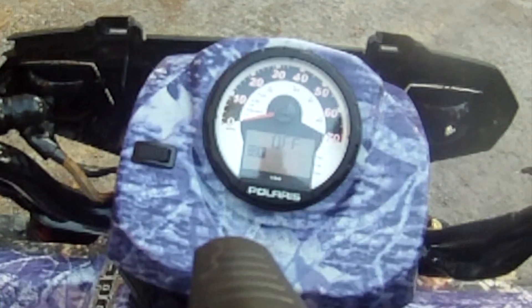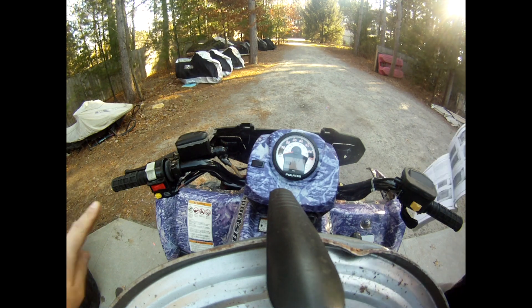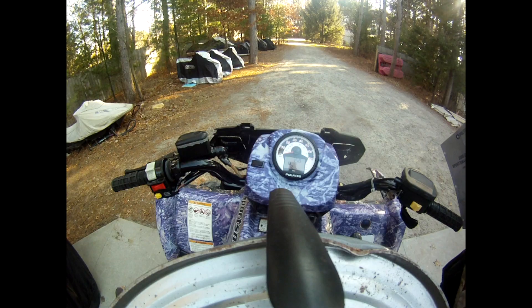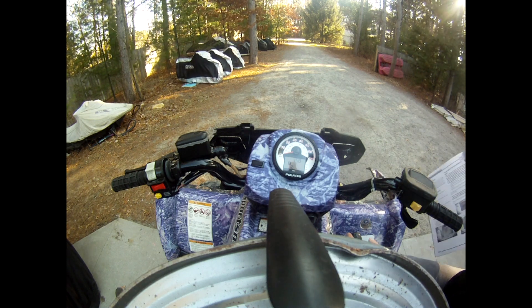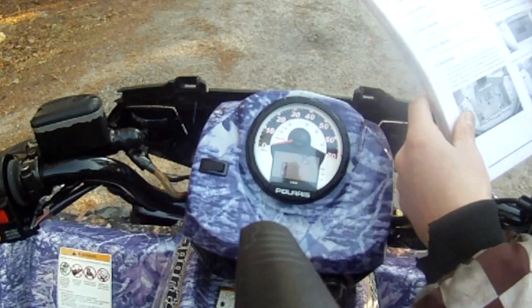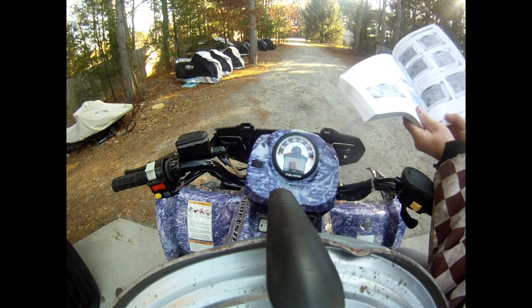The next one should be all-wheel drive — it shows 'off' because I've got it off. Then there's the gear circuit diagnostic. If I hit it again, it shows neutral, so it should read 158 ohms. I'll put it down to reverse and in reverse it should be 75 ohms — that's what it's measuring.